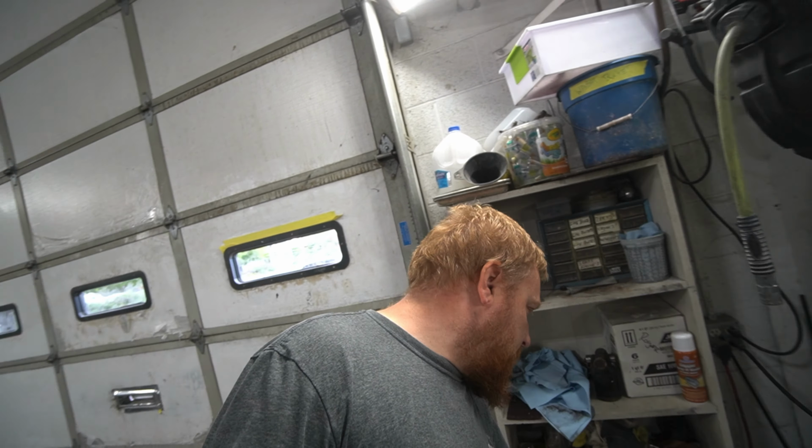Alright, so that had been wet sanded with 1,000, cross cut with 1,500, out to 2,000. Then I started polishing with this new pad. I don't even know what the brand name of this is, but it cut pretty dang good. I got it off the Cargo guy. It's a Sims Arnold Speed Foam, yellow something or other. It's a cutting compound, but not a very aggressive one.